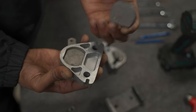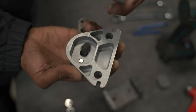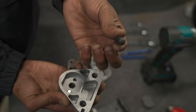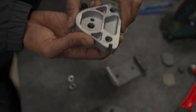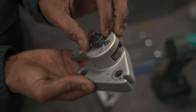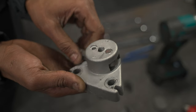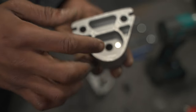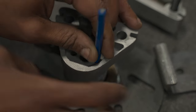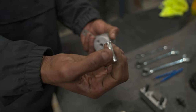Go ahead and open up your caliper and remove your puck-style brake pad, the brake pad barrier, and the brake pad pin. Once those are removed, you'll see a silver pin that goes through and holds the caliper. Remove the locking nut so the pin is clear, then go to the other side and use your punches to knock that pin out. It should slide right out — go ahead and remove it completely.